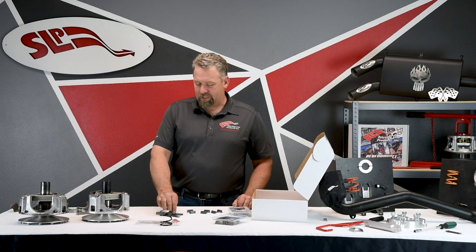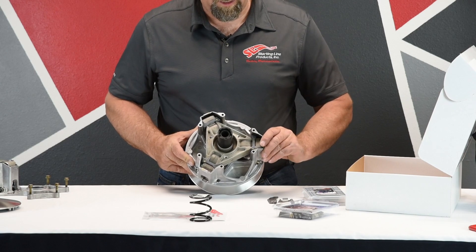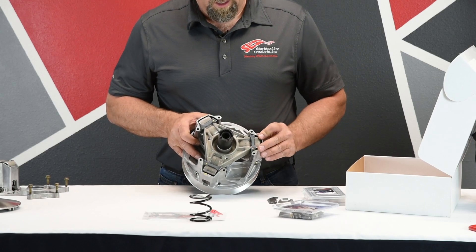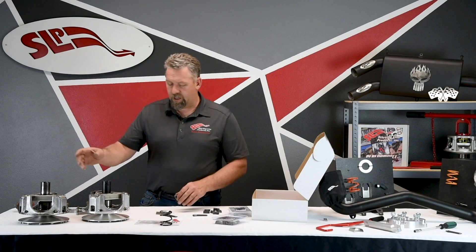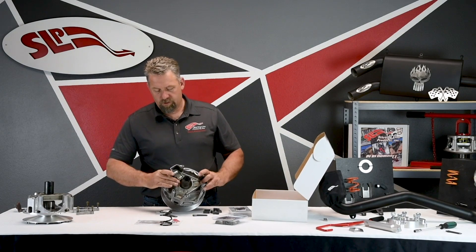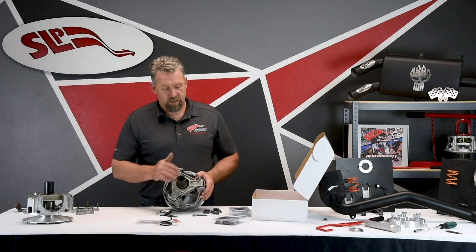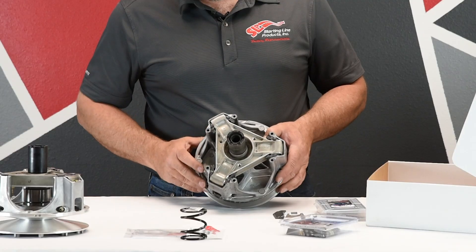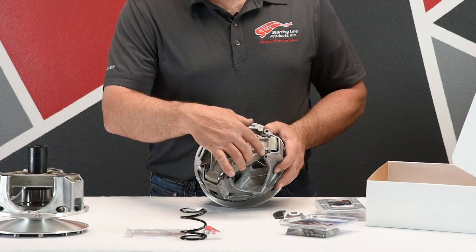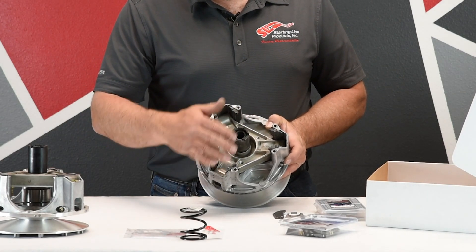The power puck replaces the stock slider and the stainless steel piece behind it, putting everything in parallel with each other. I've got another clutch here to show you — you can see there's no slider on the three towers. There's a little clearance built in and it's designed to be self-cleaning of dirt and grime, sliding on the tower and keeping everything parallel through its shift.